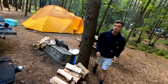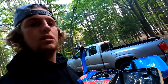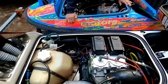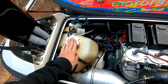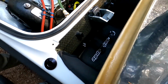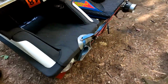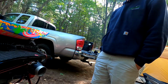Hunter, did you talk about it? I explained it a little bit. I told him it's got a B-pipe, it's a ported 701. It's a Paul Lear built ski. It's got a Paul Lear ported 760, 38 Mikunis, internal fill, 24/7 pole bracket, lowered, all carbon reinforced. It's got the back plate that's reinforced, X Metal trim system, Blowsion steering, X Metal pole, 24/7 lowered hood and nose piece, and then it's just a stock pump with extended ride plate, trim, whole nine yards. So it's pretty dialed. Finally got it to run a little better.